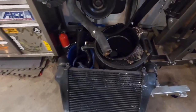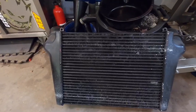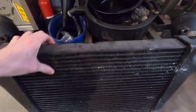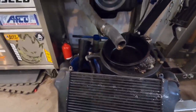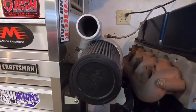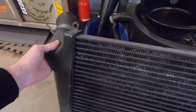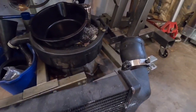So what you can do is get an air-to-air intercooler — this one here is off a little diesel truck, it's not the prettiest, but it's an air-to-air intercooler, not a radiator. How it works is pretty self-explanatory: boost comes out of the turbo, goes into this inlet, is cooled through these fins, and then goes into the engine.